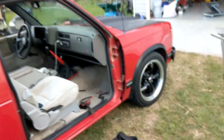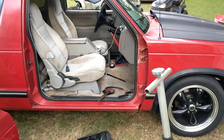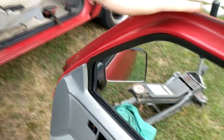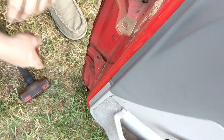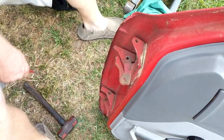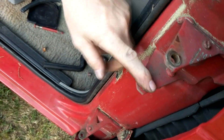The spring came out. I heard it's easier to put the spring back in with the fender off, so once we pull the fender off we'll try to put the spring back in. Now with the old bushings — we tried to use the old pins but they're just going to fall out. The way the pins and bushings are set up: the bushing goes on the door side on the bottom and on the truck side on the top. The top truck-side bushing is the one that wears out the quickest — if you find it on the ground you'll see half of it is gone.